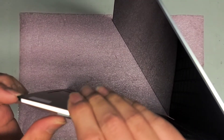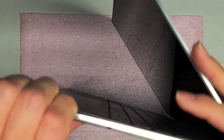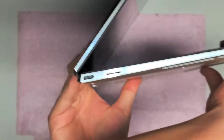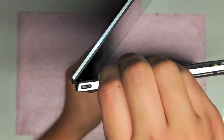We're going to go along the side here now — same thing. Get in there, and then push on the back with your thumb. If you don't have fingernails, you can try doing this with plastic pry tools, but I find fingernails seem to work the best since you have good leverage pushing with your thumb as you kind of pull back like this.